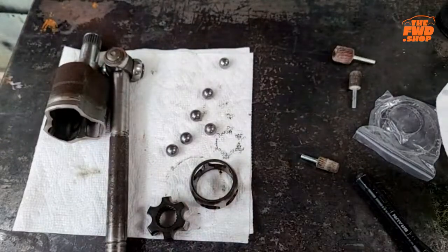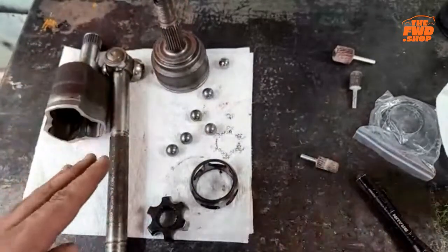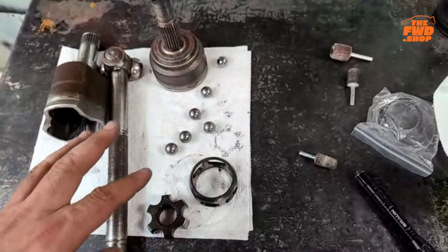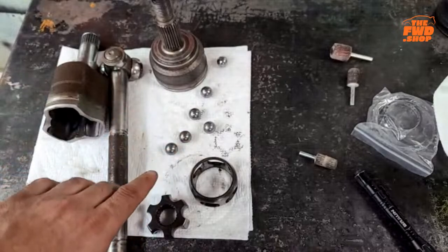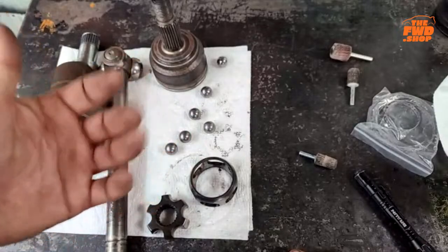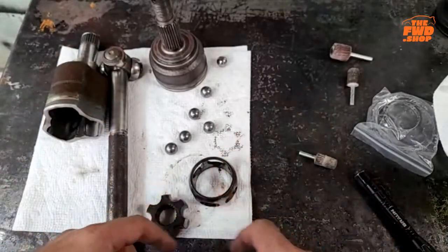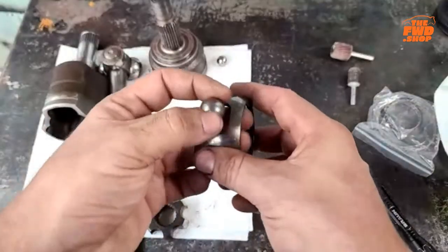Now, it's really easy if you want to do this yourself. By the way, this was a cheat in Spec Miata because, their racing is so tight, their rules specifically state you are not allowed to modify any OEM part unless basically specifically told you could. The rear CV axles in a Miata have the same exact type of setup with a CV, and this reduces friction, which theoretically should free up horsepower. For us, who can just build 5 more horsepower or 10 more horsepower, not a big deal. Spec Miata, where they're literally fighting for 1 or 2 more horsepower, this matters, okay? So that was why they got DQ'd, is they took the axle off and they were able to do this.